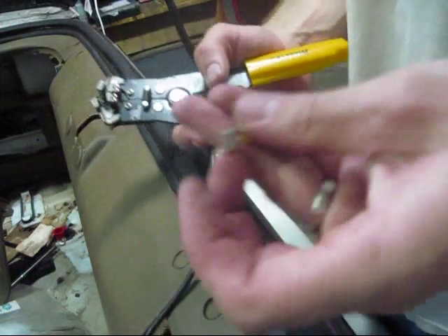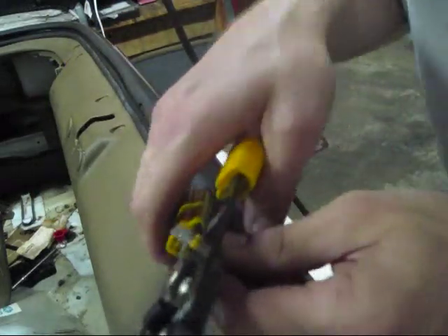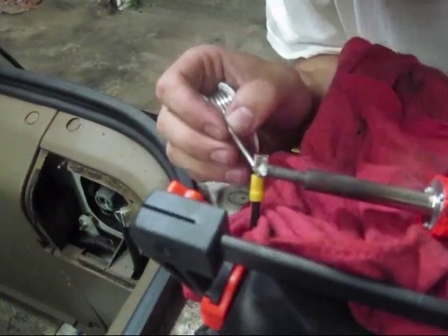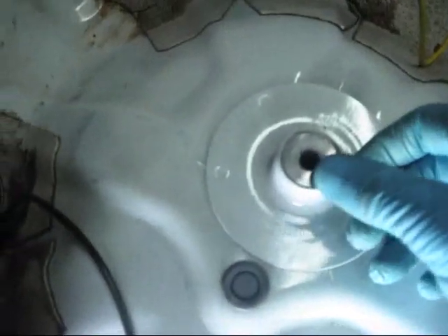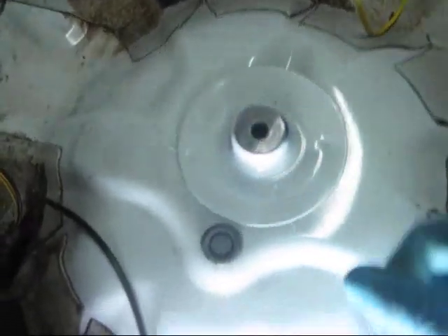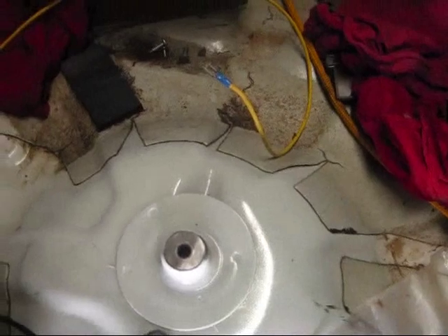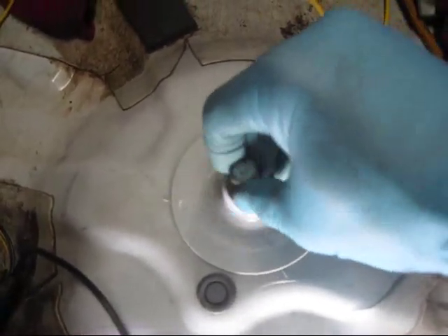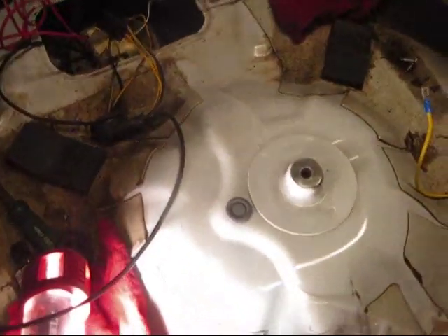This is the other end of the power wire — it also goes with that sill piece, so it gets one of these connectors. The fuel sending unit is in, and I've cut the ground wire here. The best ground I've found is at the spare tire location where it used to go. I used a wire wheel on my rotary air tool to clean that off, and then we're going to use this bolt here to connect the 10 gauge wire and make that our ground for the fuel pump.